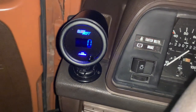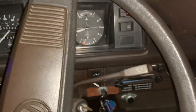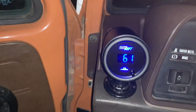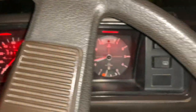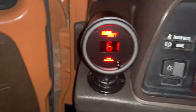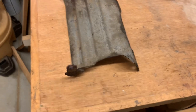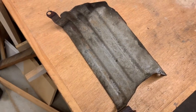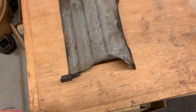That's reading zero. We've got some valves clacking. Let's change it to match. I'm going to let it get to temperature and see what our leak situation is — see if anything is spewing oil. The adventure continues. I put the Mann oil filter on there and it was really snug, as you could see, but it was scraping on the paint and I couldn't get it tight enough. So we had a leak, and what it was scraping on was a heat shield that's up against the manifold, scraping right here.